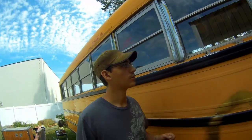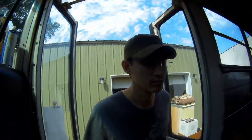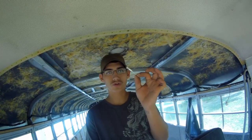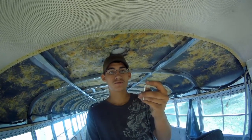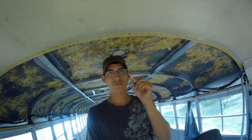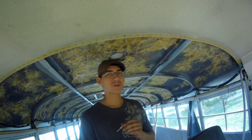And then what I'm going to do is I'm going to go back, and I'm using structural aluminum rivets. And I think I have some. Let me show you. I do. So this is a 1/4-inch structural pop rivet. It's called a blindside rivet because steel rivets, you need an anvil on the other side. So this will just slide into the gun. It'll pull this, we're going to call it a plunger. I know it's not called a plunger, but it'll pull this plunger in and make the aluminum rivet expand. I want to try and replace the rivets with something as close that I can while still it's time efficient. So this is what I'm going to be using to replace the steel rivets that I'm now removing.